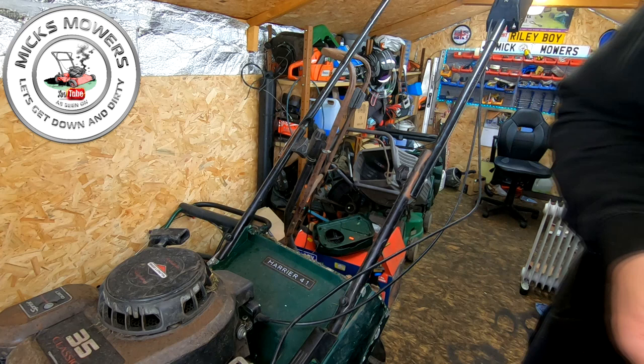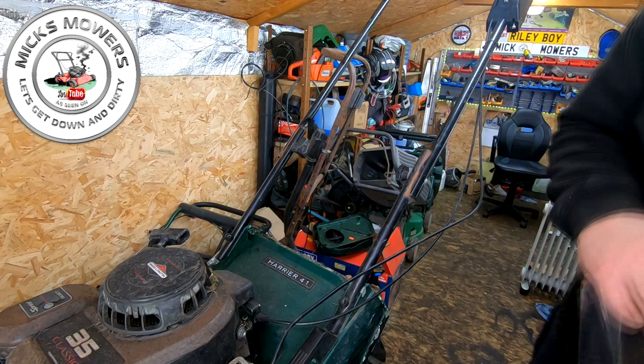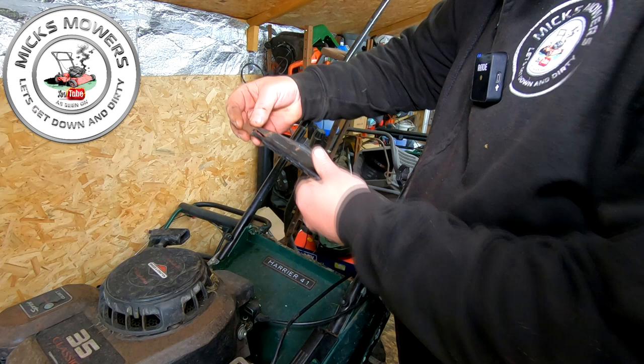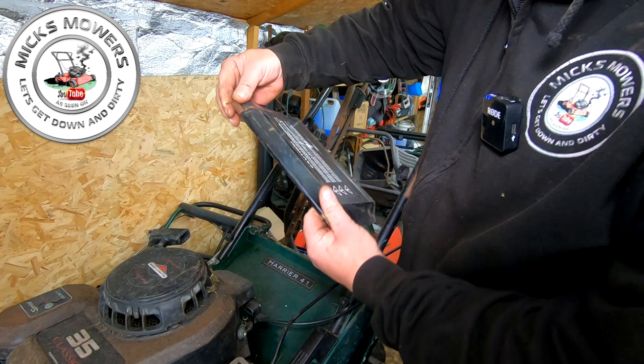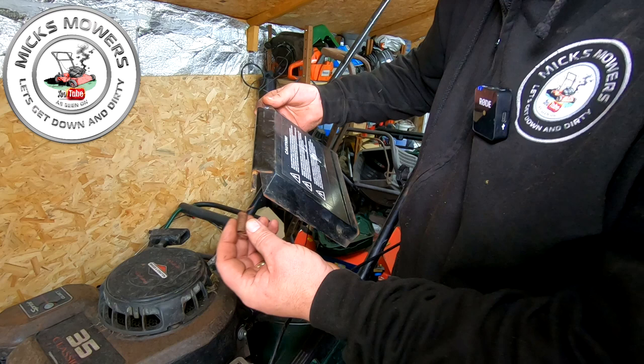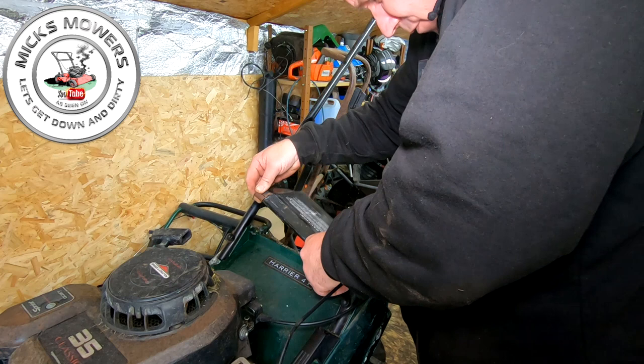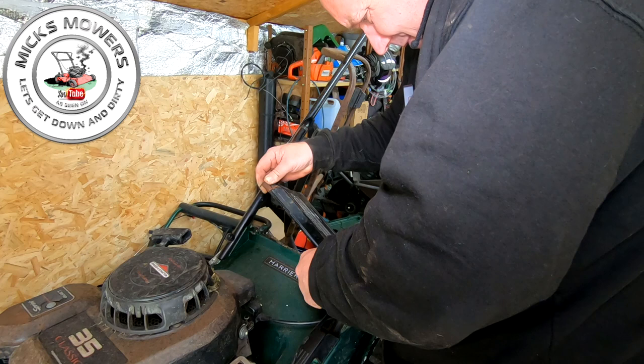Let me find my bar. What did I do with my bar? There it is. My bar, my springs. I'll figure this out now. Bar goes in to there, and we want a long dog tail, which could be that one there, which rests across that. That goes against the machine. So this side here, longest leg, goes down here, like so, and then this bit here goes against the machine. So put it into place, pull the spring out, without jabbing itself in the fingers.